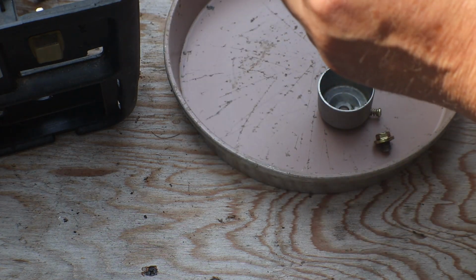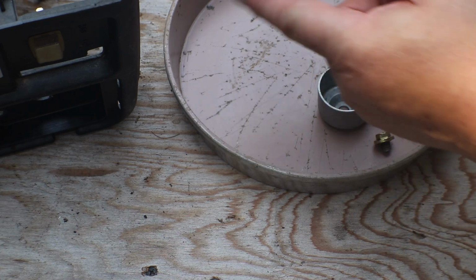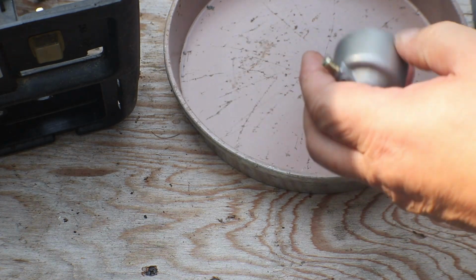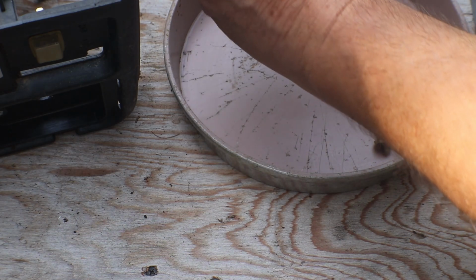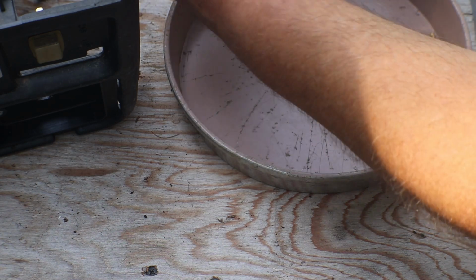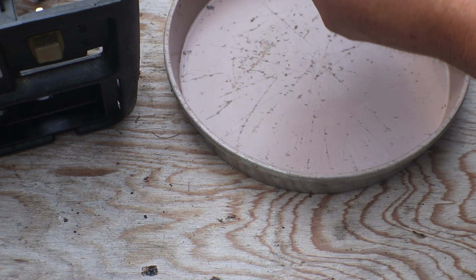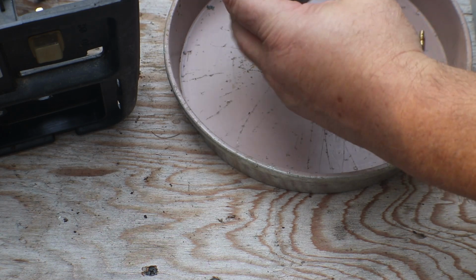And they use it once and then it goes home, sits in the garage and never gets used again. Alright, what I like to do is I like to blow through these after I get my needle and seat in. You can blow through it with it hanging down. And you can't blow through it when the float's closed. Let's see, we need this. Let's see, that's the front place. Probably going to be off to the side a little bit, so you can sneak in behind the case or that panel and get your screwdriver on it and drain your bowl if you need to.